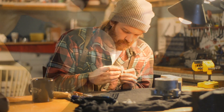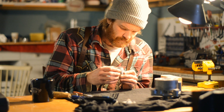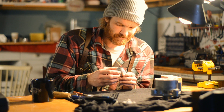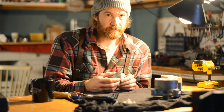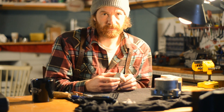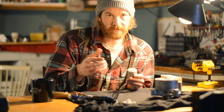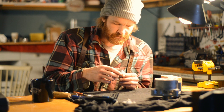That seemed to work okay. I've got clearance all around the ring now. There's not much clearance — very racy clearance. Between 0.05 millimeters and 0.04 millimeters or so. That's about two thousandths for you imperial people, which isn't unheard of in race engines. Should be fine for testing.